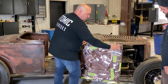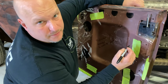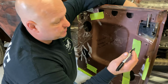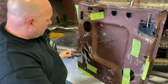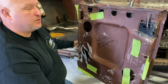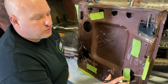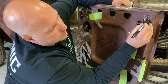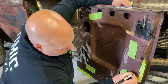We're going to slide it over the door and push it in. You can see here, I'm going to hold this door from hitting the actual body or the exhaust. Randy just brought that up, which is a common thing that we do. Before we make the panel, we make a strap that straps this door to the inner kick panel. Before that, you can push a lot of these hot rod doors right into the exhaust. You want to be really careful not to do that. What we're going to do is mark all of our holes where we want them.